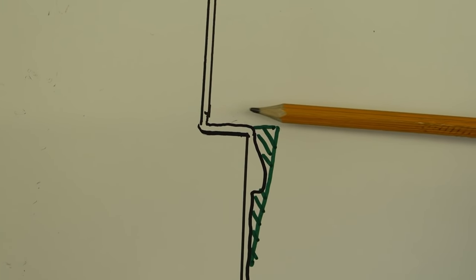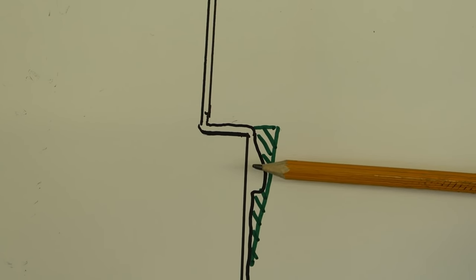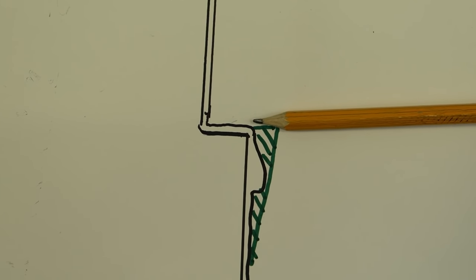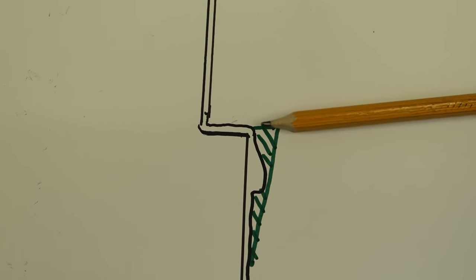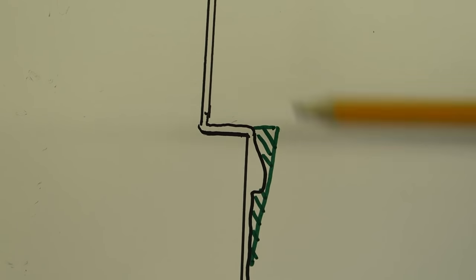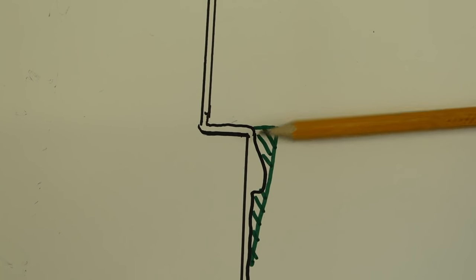This is the detail on the van with the run hanging over the side, and I've put the filler over it. I've masked along there, saving the detailed edge, because what I don't want to do, as I said, is flat this down and end up sanding right through on the edge, which could easily happen.